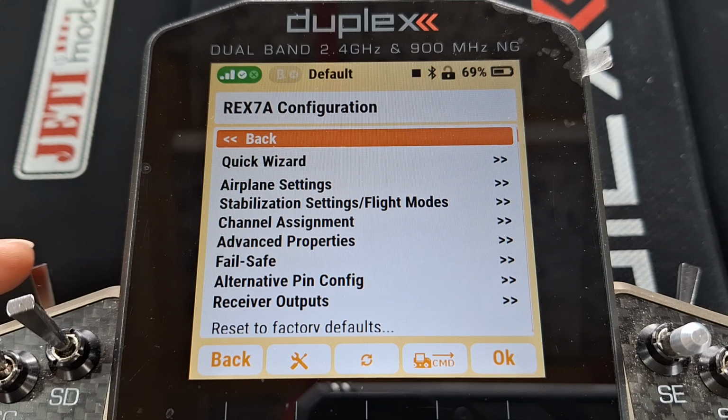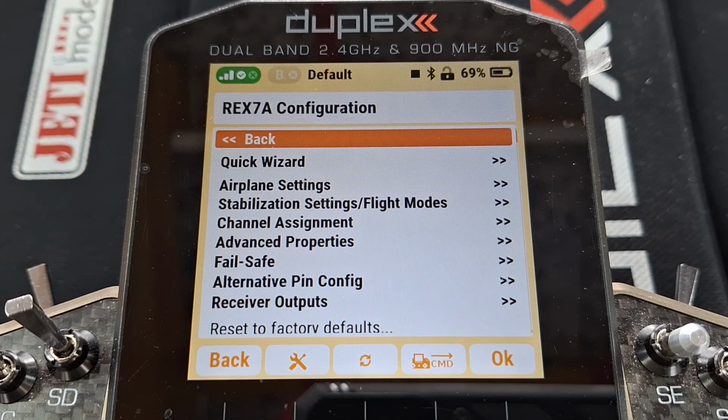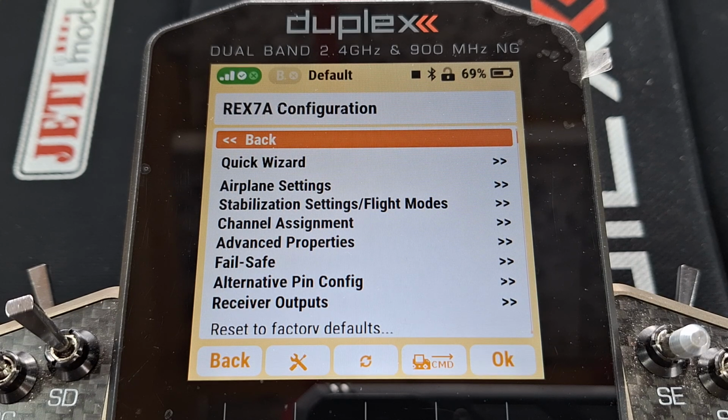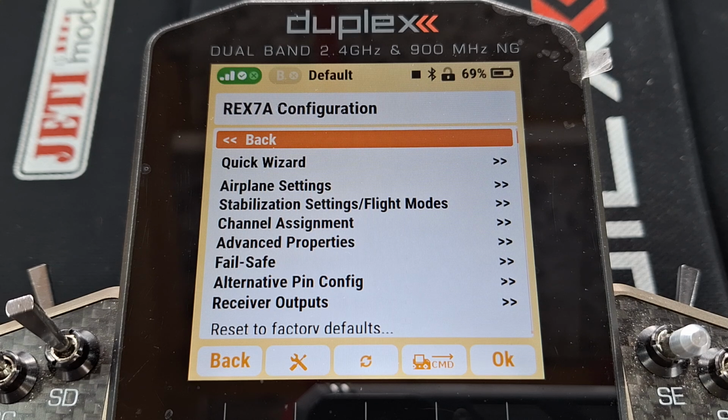And also he wants, when he switches it down, the gyro stabilization of the nose leg does not come in straight away. It waits until the leg is down, and there can be very good reasons for this. Sometimes the yoke on the wheel can be very tight in the space, and if the thing's rotating it can jam inside the aircraft. And some steering systems rely on the leg having a little pin at the front of it, which then engages in the steering yoke on the retract, but only once the leg is fully down. So you don't want the servo to be rotating the steering yoke because of the gyro until the nose leg's all the way down and engaged, otherwise it would miss. So all of these can be solved, and this is how we'd go about it.